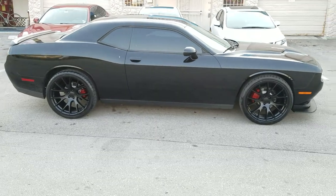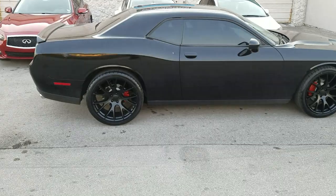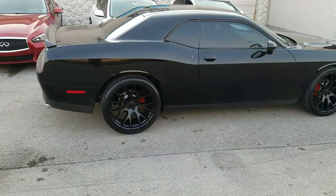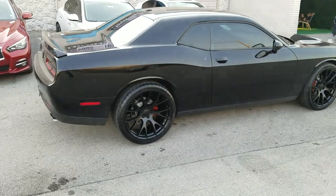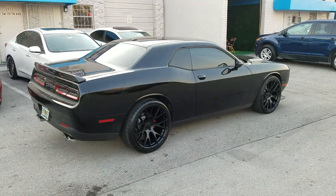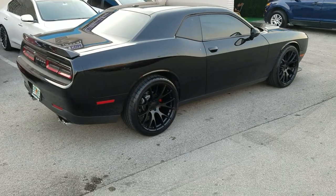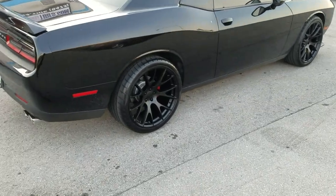Also, when you're putting these on, because of the way the suspension drops in the rear, it will seem like these wheels will not fit. But once you put it on the ground, the spacing will clear up between the lower control arm and the lower suspension on this vehicle, and it'll fit with no problems. Just tighten it down in the air as far as you can, then tighten it all the way once it's on the ground.